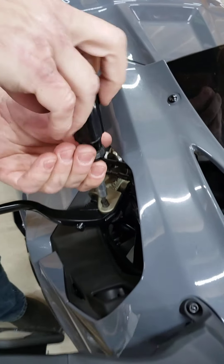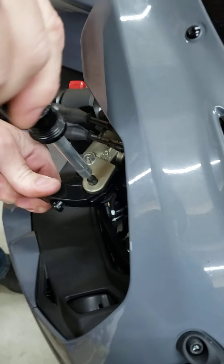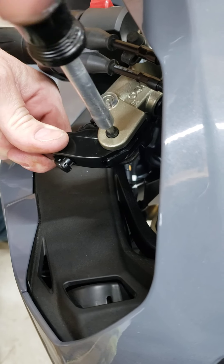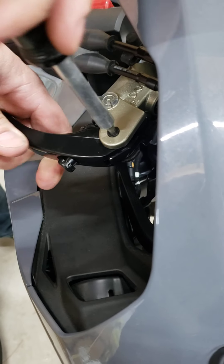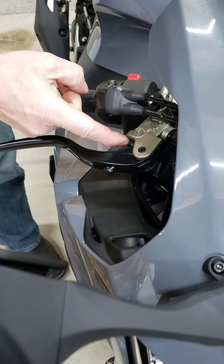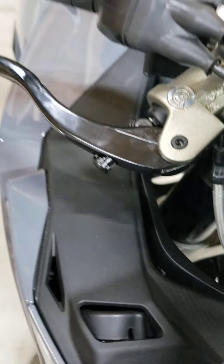Take your H4. Hold your lever with some security just to keep it in place. Thread it down into the bottom of the master. Just give it a good crank — a little snug, don't need much. Make sure your rubbers are all seated up in your Brembo real nice. Looks great.